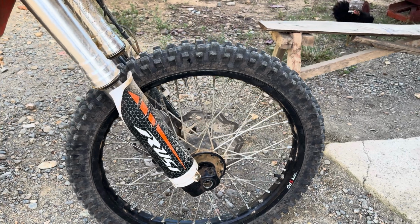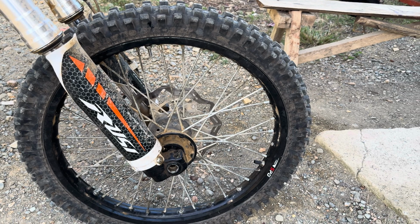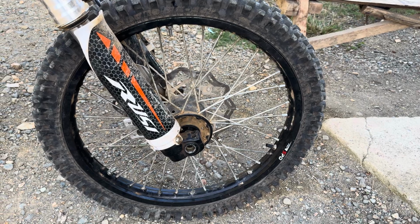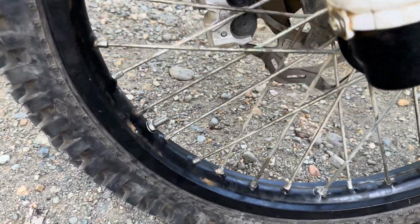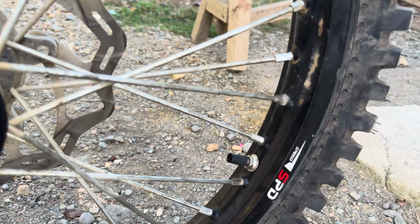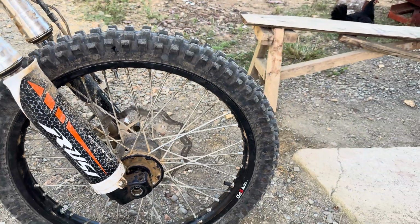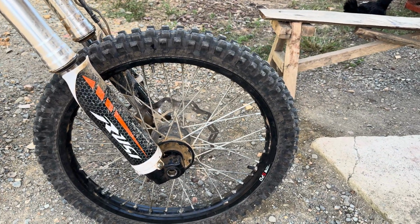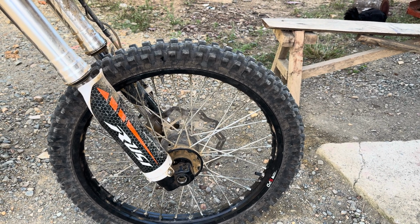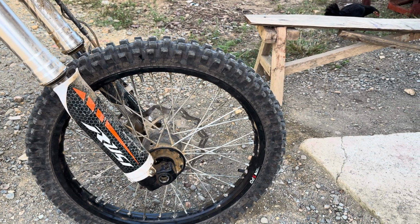So I don't know if you can see it. The 12 o'clock or 11 o'clock position is a rim lock. Over there at 4 o'clock or something is the air valve. If you can look in there, there's a rim lock there, there's a rim lock there. I've got 2 rim locks and an air valve where you put air in. I triangulated them because it's a 36 spoke wheel, and I thought that gave the best balance, and if nothing else it made it look decent. And it measures out to 12 spokes.